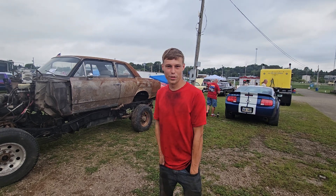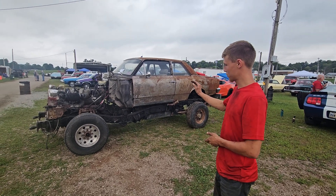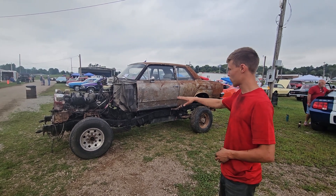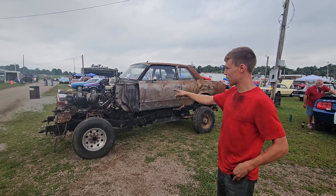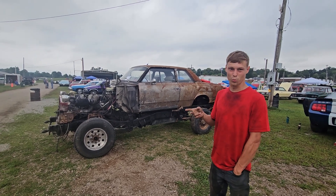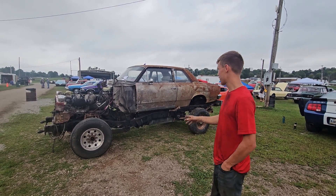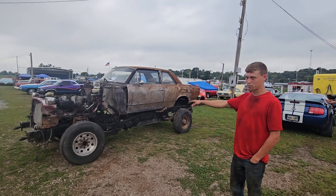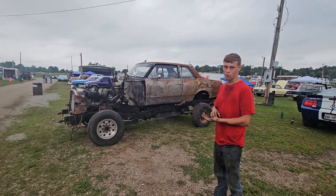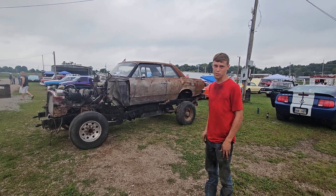I'm Logan McCoy, I'm from Benton, Ohio. This is a 1968 Rambler American body. It's got — I'm pretty sure it's a 1999 5.4 Triton F250 frame. I took that motor and tranny out, took the cab off, everything like that. Then I had a 2007 6.0 Power Stroke with 480,000 miles on it — set the motor down in there. I did a four-wheel drive swap on one of my Super Duties, so I had the two-wheel drive tranny laying around with about 300,000 miles, so I slapped that together. Built my own driveshaft, tore it in the frame 15 inches, fabricated all the body mounts and everything. I did all the wiring, plumbing for the brake lines, the fuel lines, hydro boost — everything. I did it all myself in seven days.